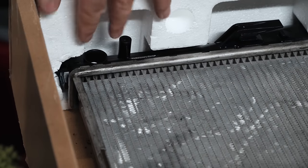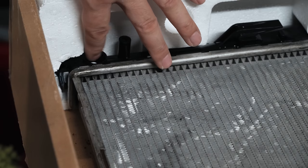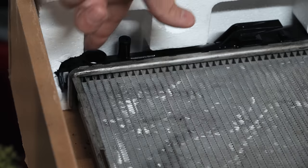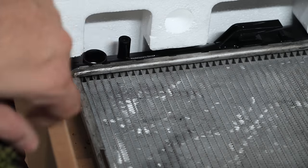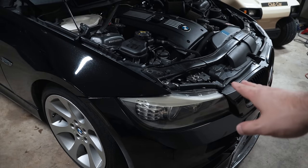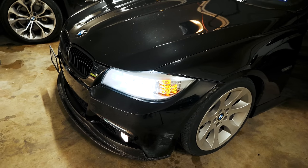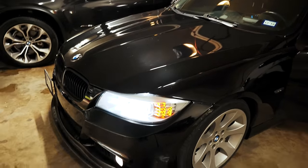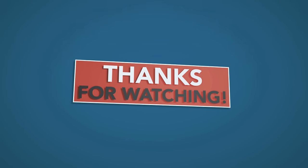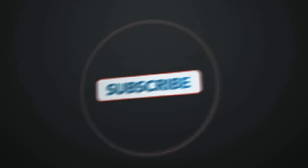So here's my old radiator — that's where the transmission cooler line would go. The line just slides in there and then you bolt down the side of it. There's an O-ring in here — if you can, get your hands on an OEM O-ring to replace that before you put everything back together. Even if you get a minor leak when you first start the car up with a couple heat cycles, it'll probably situate itself. But had I known in advance, I would have bought that O-ring. I'm going to start the car up, let it run for a while, make sure it's leak free. Leak free, everything is good to go. This shows you how to replace your radiator on your E90 BMW, specifically an automatic 335i with the N54 motor. If this is the first video you're catching of mine, consider subscribing — I do upload regularly. Thanks for watching.